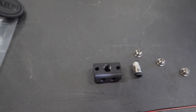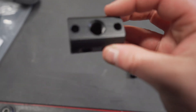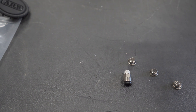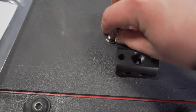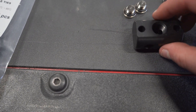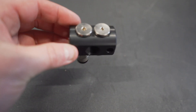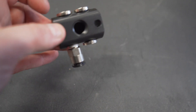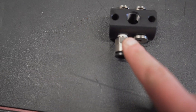Now that I've got the hole drilled in the compartment, I'm going to prepare the hose fitting and filter block for installation. I have three allen-key block-off plugs — I'm going to insert all three of them plus the actual hose fitting into the block. Snug the three plugs with the small allen key, then snug the hose fitting with your 13mm wrench.